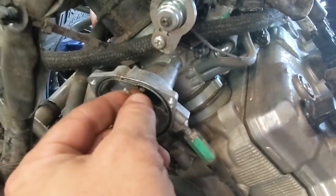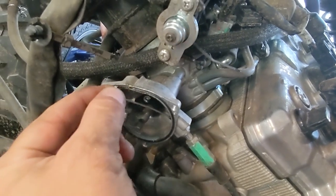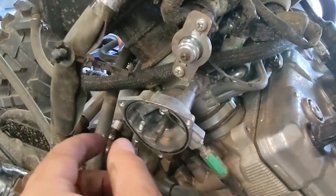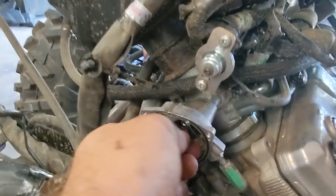So we got to the little area where the throttle cable actuates. The cable is loose on both sides and we can see the cable moves totally freely — cable restriction is not related to the issue here. However, the butterflies, which are turned by this mechanism, stick pretty bad.